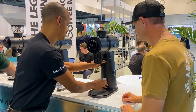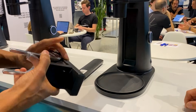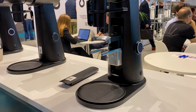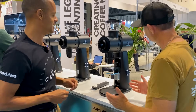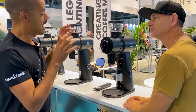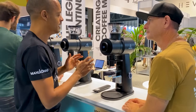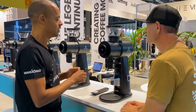A few other features: removing the front panel reveals a clever design that lets you attach a portafilter holder, so you can use it as an espresso grinder if you wish — hence 'Omnia,' all. All adjustable for every handle. The most complex and proudest part of the development is the adjustment mechanism. The numbers displayed are the disc distance in micrometers — metric units with real meaning. A lot of people like that manual, tactile approach of the EK 43, and that's preserved here.